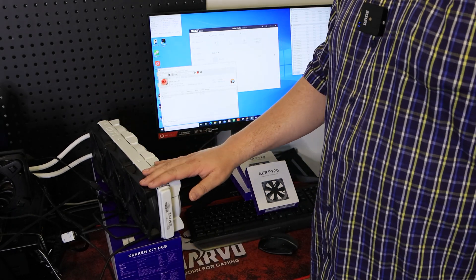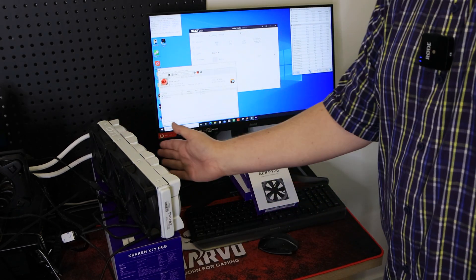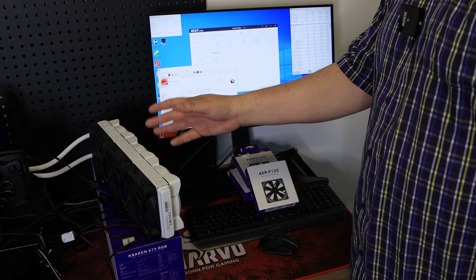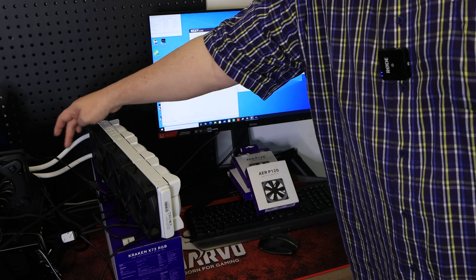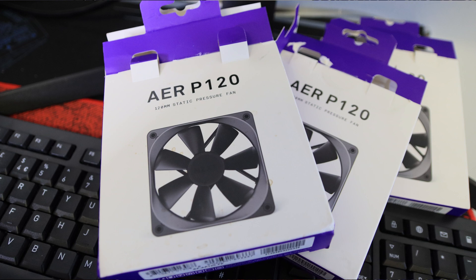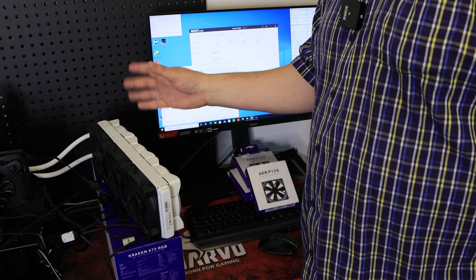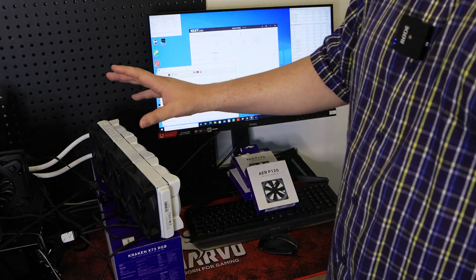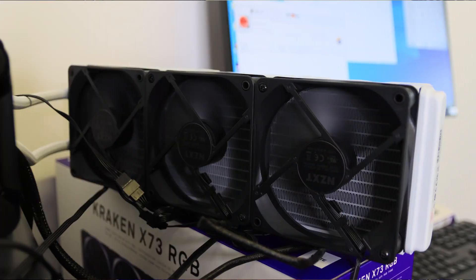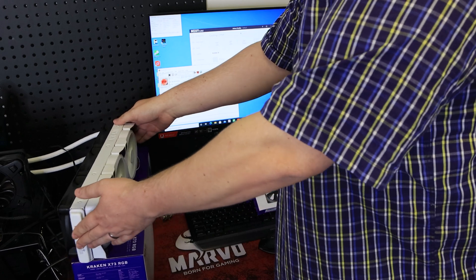So we've got the water cooler set up with the three extra fans in a push-pull configuration, which basically means these front fans on this side — the white ones — are sucking air in, and these ones are pulling air out. We've actually found that temperature-wise the liquid, at least what's in the tubes and within the radiator, has dropped by about five degrees since we added the extra three fans. On top of that the actual CPU seems to be running quite a bit cooler — roughly high 50s to low 60 degrees instead of high 60 degrees.